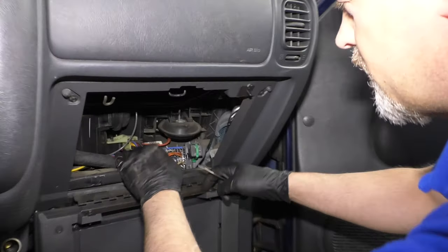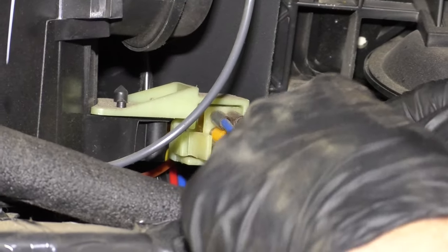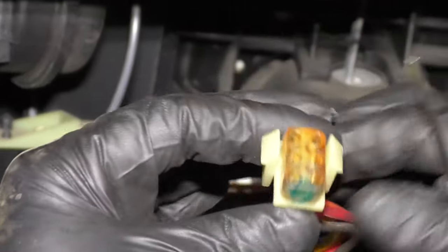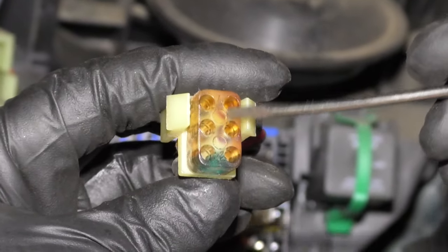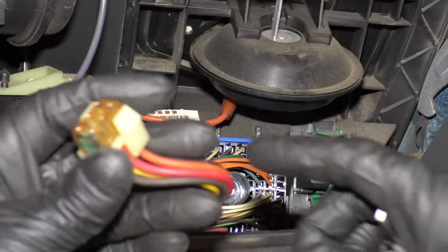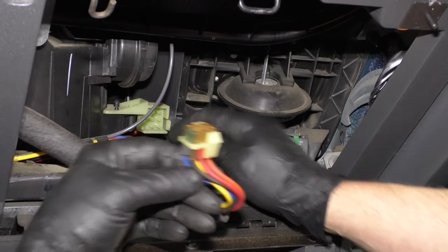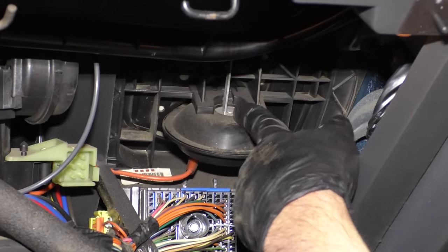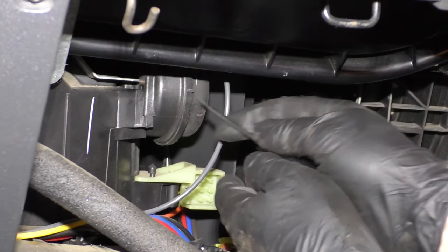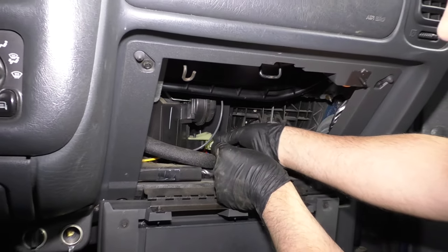So behind the glove box, if you flip the glove box down, there's this junction right here that goes to your HVAC system. If you just get a little screwdriver in here and pull that out, you're going to see if there's any fluid in there. If you see any oil type fluid, there shouldn't be any oil in there at all. If that happens, you want to replace that switch, but you also have to clean out all these lines, and that can be somewhat difficult. Here's the fresh air or recirculation door actuator, and there's another actuator and a couple others in there as well.